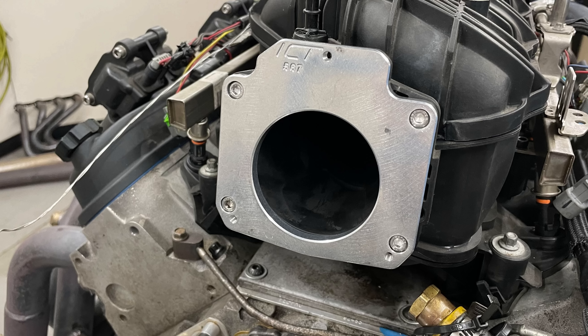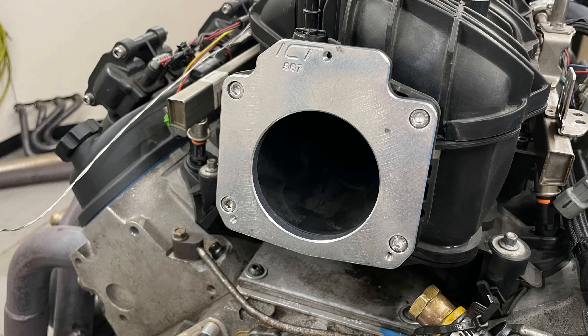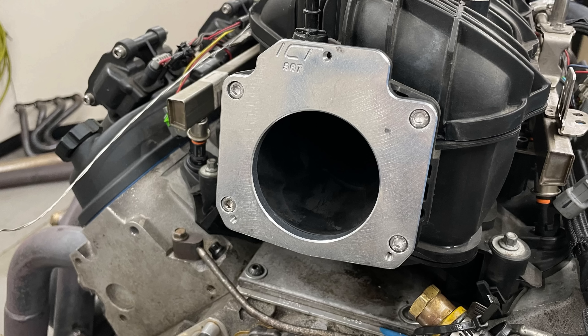Scrolling back out to see the rest of the curve, we only had a little bit of a power change here. What we'd expect is if we ran this on a six-liter with good cathedral port heads and a good camshaft — where the six-liter might be making 500 or even 550 horsepower — and you tried to run the small throttle body, the difference in power would be even greater. The smaller throttle body would become more and more restrictive relative to the combination, and the gains offered by the bigger throttle body would only increase.